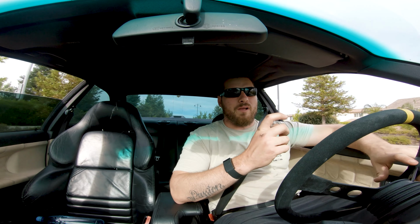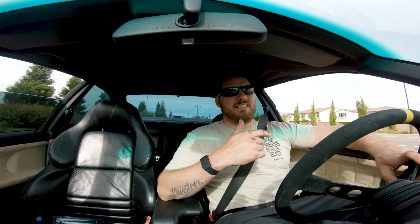For me, with the BC coilovers fully cambered in and the 20mm in the front, it just sits the wheel perfectly right there. And then if you want to know as far as the ride height between the two thread points, it's 1.43 inches. If you have calipers, like I did, measuring the height is literally a game changer as far as measuring the height.